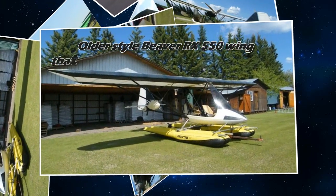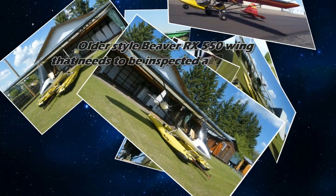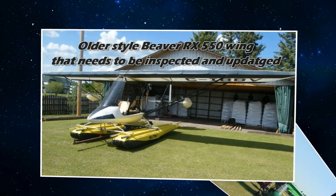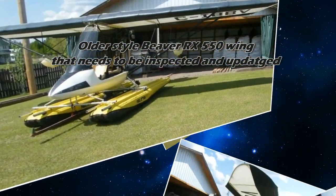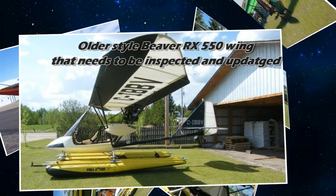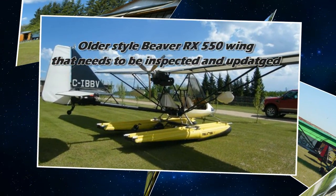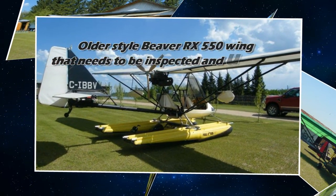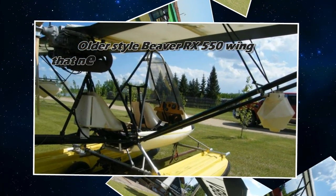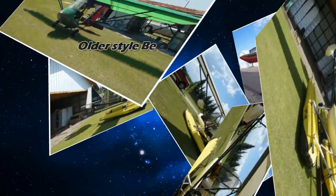How about the weight — four-stroke versus two-stroke? When they said it was 116 pounds, and we got all the components boxed, it was 116 pounds. In our airplane configuration with a 582, the mounts and everything comes to about 127 pounds with the RADs and oil injection tanks. We're either bang on with that or possibly a couple pounds heavier — I can't see that 11 or 12 pounds of extra components will be a concern.